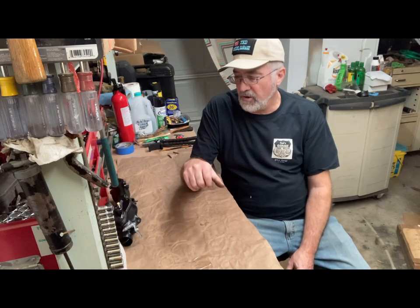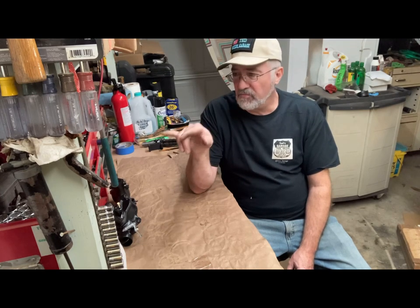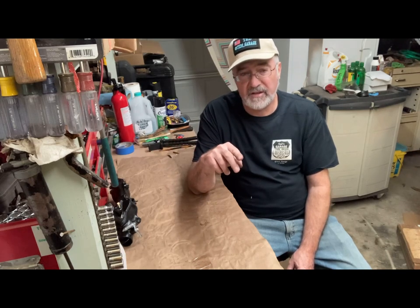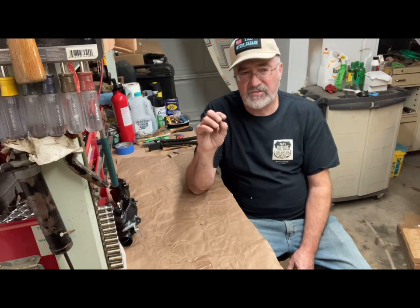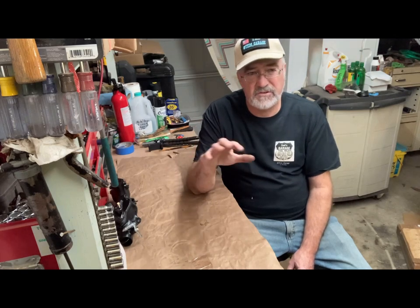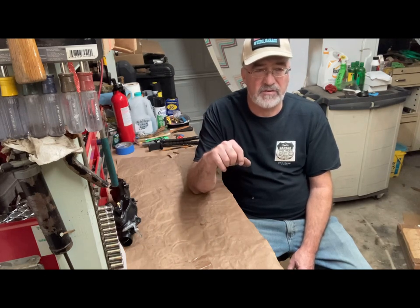I may do another video on actually checking the fuel level on the car and setting the float level. And then I have a rebuild kit for a Tillotson X, and I think I actually have one or two Tillotson X. And I have a gasket set for the Marvel. I think I actually have two Marvels, but I'll have to see what the jets on it look like, and if I can reuse the old jets, clean them up, and maybe locate parts and pieces for the Marvel. Stuff like jets and floats on the Marvel are very hard to find.